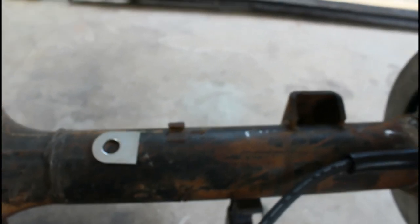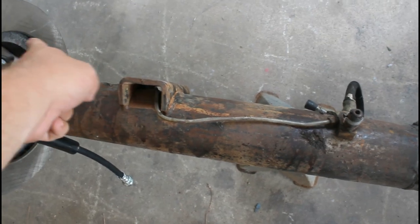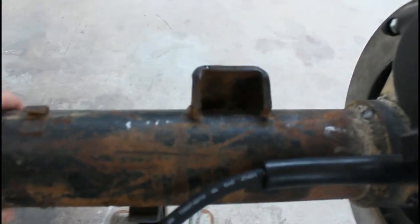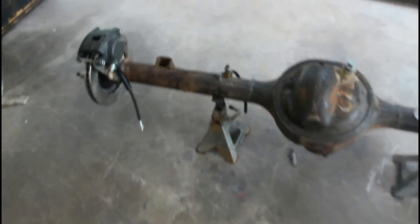The third thing I want to say — I heard this one off of Roadkill Garage a while back and I thought it was a great idea. Factory brake lines all run pretty much along the top of the axle and come up into your drums on top because that's where the bleeders are. I still use that routing, however, I'm going to move this to the back side of the axle. The reason is: if I throw a strap over this axle, I don't want it to pinch my brake line. I heard that on Roadkill Garage and thought it was a great idea. So that's what I'm going to do.